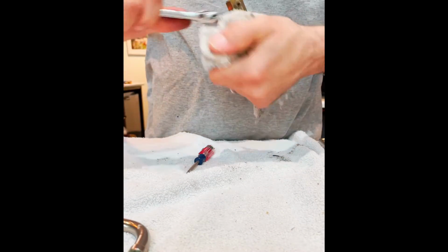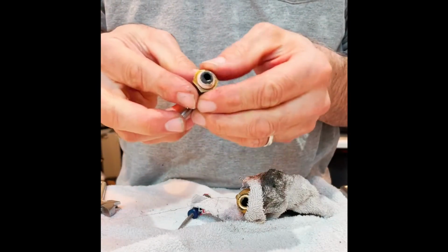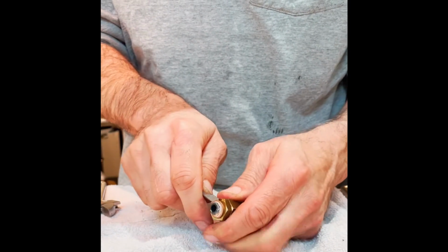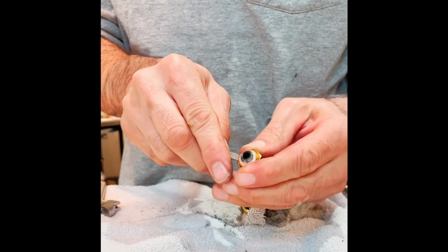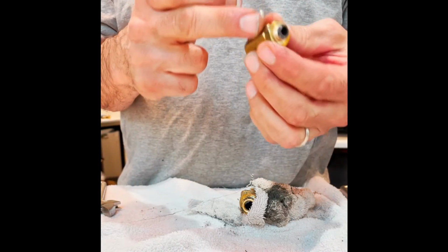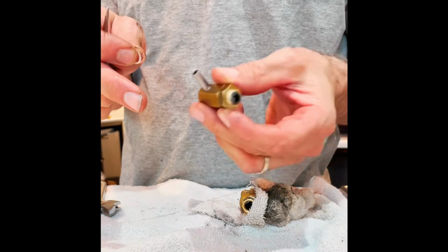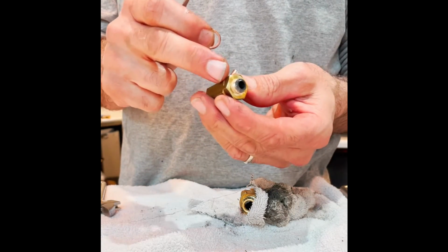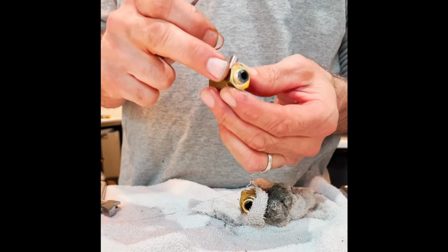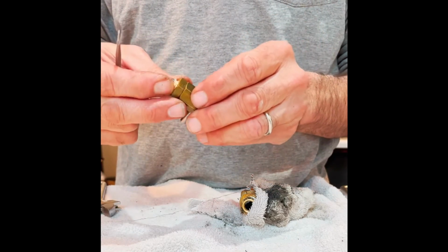Take off this pressure relief valve. There we go. Now there is a washer on here as well. It's a special kind of washer. It's the type that crushes under load. So we are going to take these two guys. There's really nothing. This is an assembly and it does come apart, and it's got a couple components in it. You can hear they're free to move, but in the steam rebuild kit, you don't have components to replace inside of here. You'd have to order these components separately. So we're going to set this guy off to the side for right now.